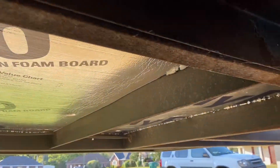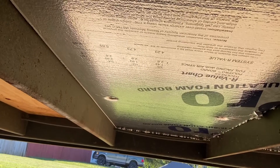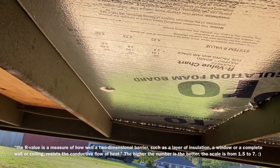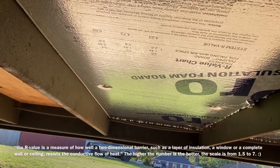We're also using quarter inch by one and a quarter inch fender washers, placed approximately every three feet apart across the length, so that we get mechanical as well as chemical adhesion to the subfloor of the trailer. Polystyrene board is installed in all of the bays. You can see the dimples where the screws and fender washers serve as mechanical attachment. The R-value on this product is about R3 or R4, so I'm not expecting a lot from it, but as I'm moving to Kansas, every little bit will help.